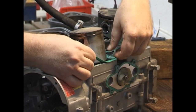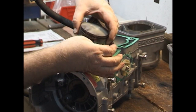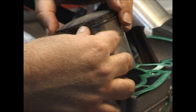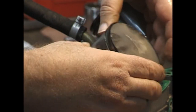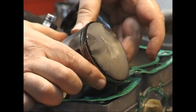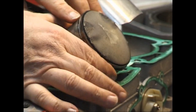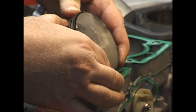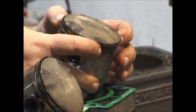As I'm going, I usually get rid of the gaskets. While we're here, I'm checking the rings. If you notice all this dark color below the rings, that is blow-by or the beginnings of blow-by. What I'm seeing here is that this lower ring — while this side is fairly free, see it move — this side over here is pretty well stuck. It will move slightly but it's gummy; it doesn't want to readily pop out of there. Where the other side will just pop out right now. So the rings were just starting to stick.